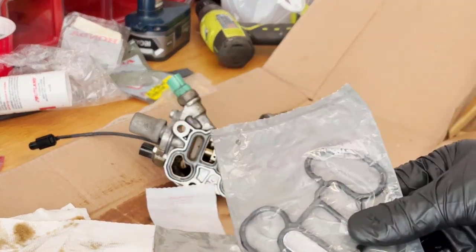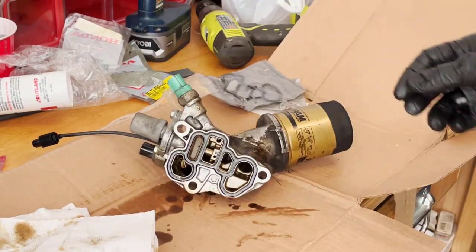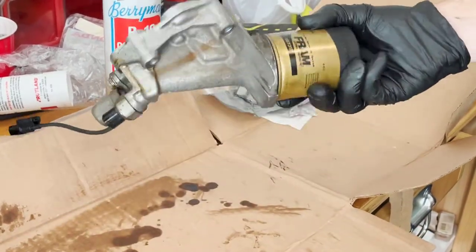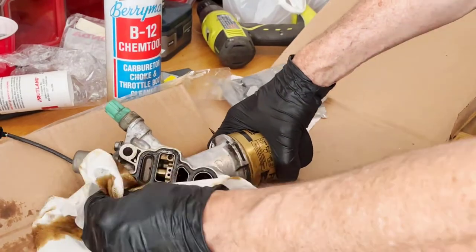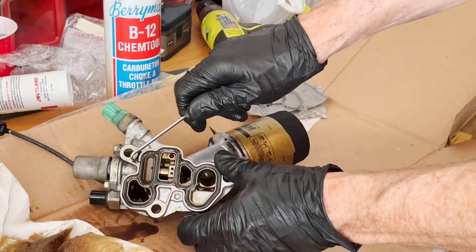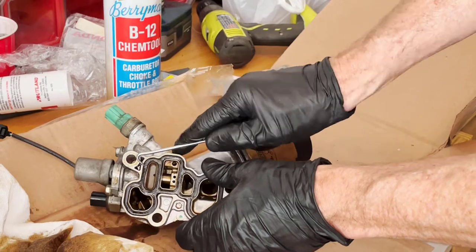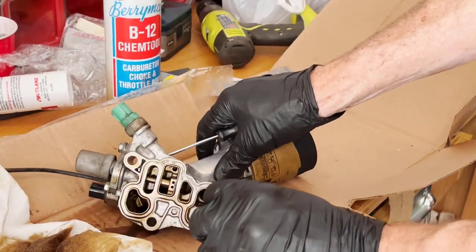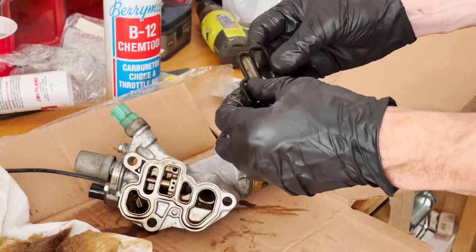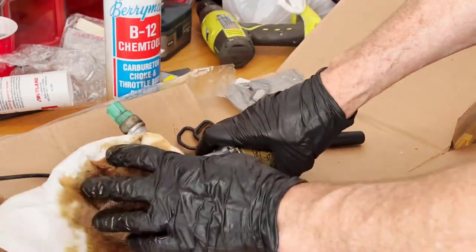Here are the part numbers for the o-rings — I'll try to put these in the description. It's the same part, just in a different bag. Those go under the switch and the sender. Here's the main gasket that attaches to the block. To get the old o-rings out you'll need a pick or a small flathead screwdriver. Oil will continue to ooze out of the VTEC housing. The old filters were still flexible but firm — not as flexible as the replacement ones — and the screen had caught a little debris.